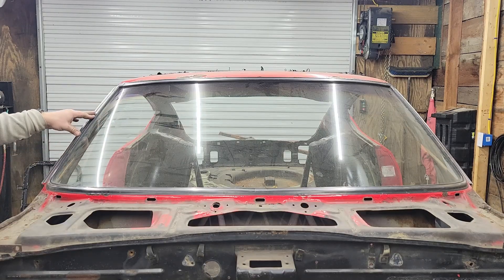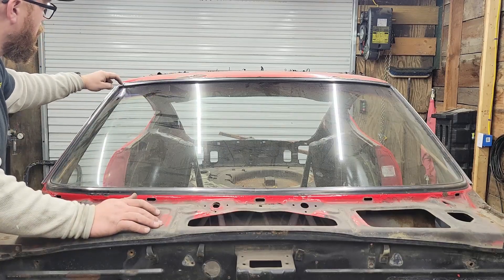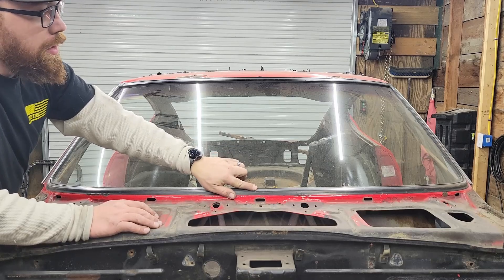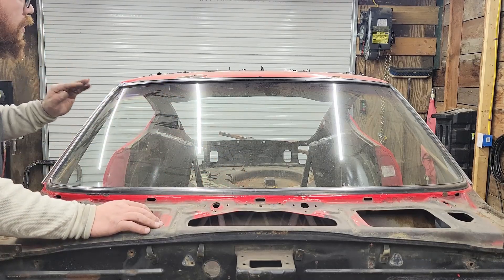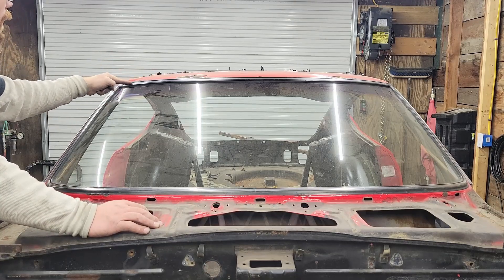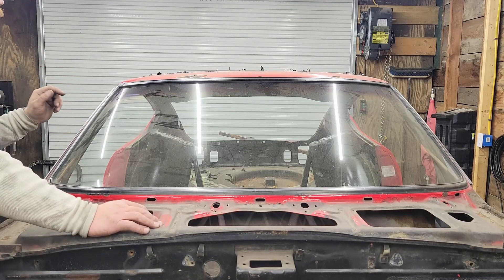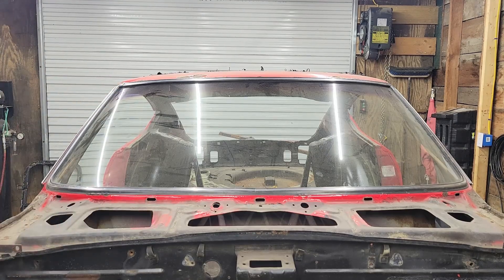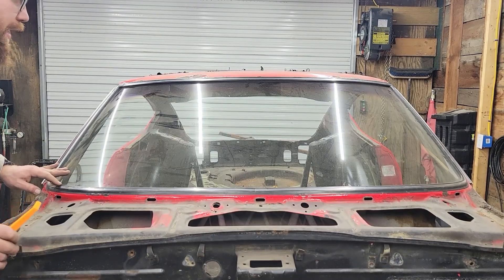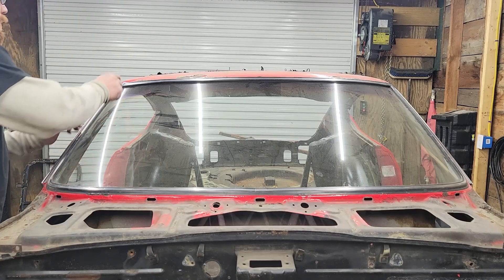I believe what we do — I'm looking at the other videos — we've got to remove this chrome trim. Just pop these off in the corners. There's one right down here, and then I believe the rest of this comes right out. And then what we want to do is slice the rubber around here, and then the windshield should pop out. We'll get started removing this chrome trim. I don't know if I'm going to put this back or paint this stuff black or something — I'm not a big fan of chrome accents — but for now I don't want to ruin this stuff, so I'm going to use an interior trim tool remover.